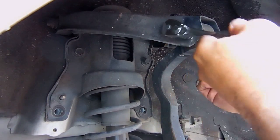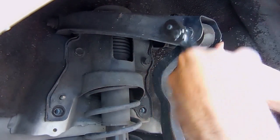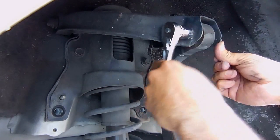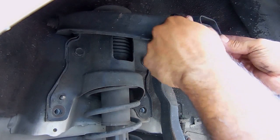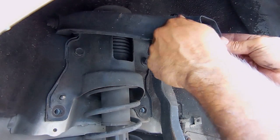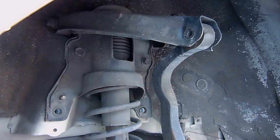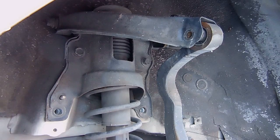Once all the bolts have been loosened, remove this bolt and that bolt, and take out this bolt right here. There's a clip right here with a nut on it — this will allow this whole section to drop down a little bit. Pull this out this way — there it comes out. Now I'm going to remove the one bolt at the bottom of the strut under the vehicle.